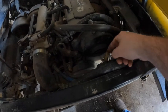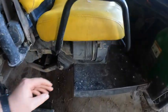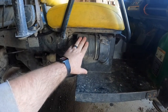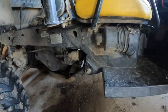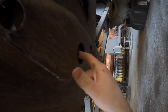Here's your dipstick for your oil. I'm not sure where the spark plugs are — I might have to take a look at that. This is your air filter here — that should be a quick, easy one. Just pop those out. And then going underneath, right there is the fuel filter — that shouldn't be too bad. Up under here looks like the oil pan, so there should be a bolt underneath there. Right here in this hole, there's a bolt — that should be for your oil pan to drain it, so we can start there.